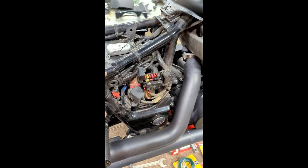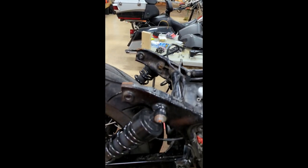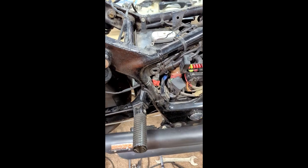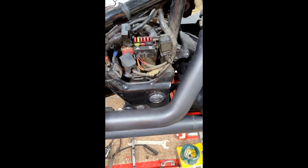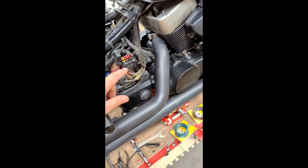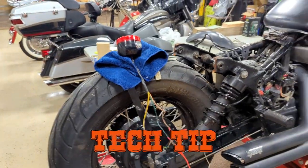We got these nice and cleaned up back here. This wiring harness for the lights goes all the way back up into here. They suggest you make your quick connects from this to your taillight assembly under here — in other words, shorten this harness and lengthen that one so the plugs are tucked down in here. If you have to take the rear fender off, you can just fish them out right here with a little extra wire, and it'll be hidden by the cover. After I make sure we've got a good connection, I'm going to cut all this back up into here so you can just pop the cover off and have some quick disconnects for your fender.